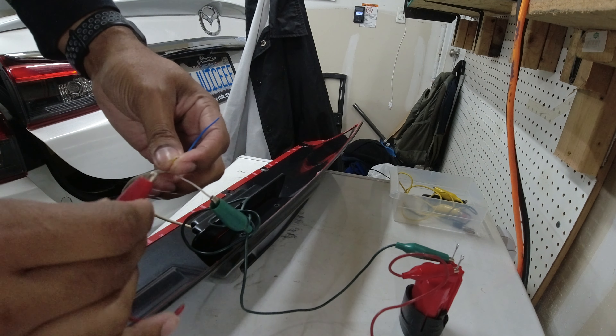Now on the MV Tuning wiring harness — evidently the wire colors are not consistent across their brake lights; they use whatever wire colors they have in stock at the time. We need to figure out which one is the brake light and which one is the parking light. Guessing that white is going to ground — we're going to go white to ground and then see if it lights.